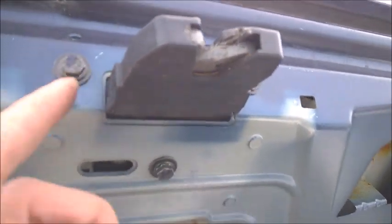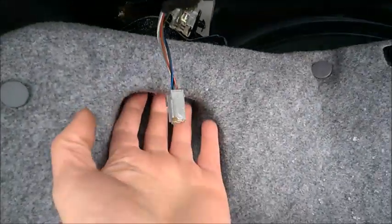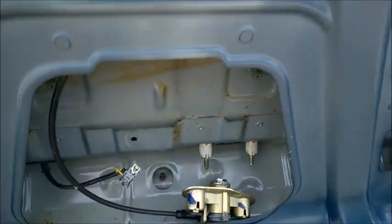Quick tip when you want to replace the locks on a Saturn. So you have this trim — just pull on this clip, it's not too bad. But sometimes they are stuck, and sometimes you also have these kind of handles which are stuck in there. So just gently remove that trim, and then you have these three bolts.